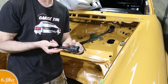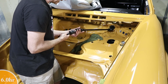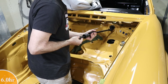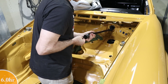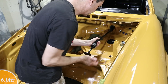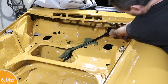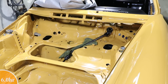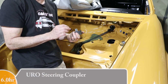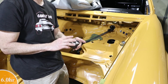In a previous episode I already reconditioned this bearing and painted this shaft. This is where it attaches to the steering rack with the rubber coupling — it has to follow the key, and this opening has to be where the bolt passes through. This is the new rubber coupler from URO, and it should go in exactly the same as the old one — I've already checked the measurements. The only thing I'm missing are the lock tabs, which I need to order new from Porsche.